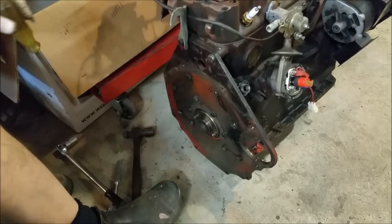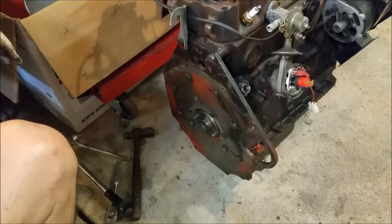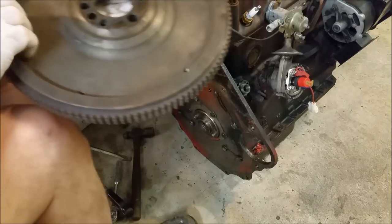Okay, that's not the news I wanted - because that rear main doesn't look to be leaking. I need a closer look. That's the reason the flywheel is difficult to get off - it's got dowels on it. I thought it was recessed. I'm a bit bummed out because I'll show you why.